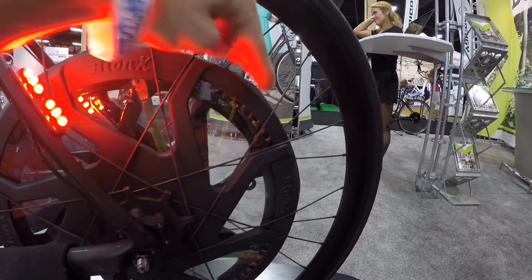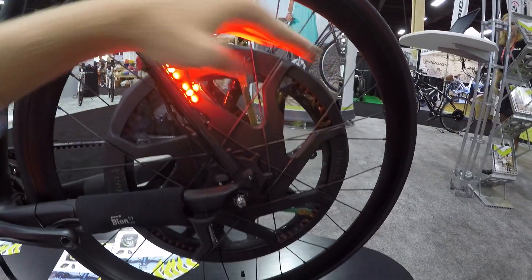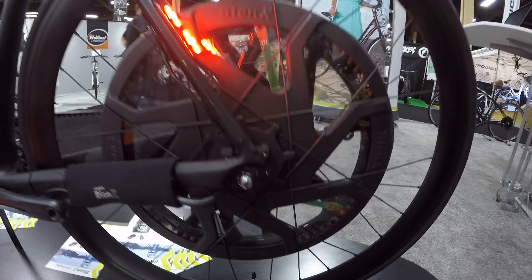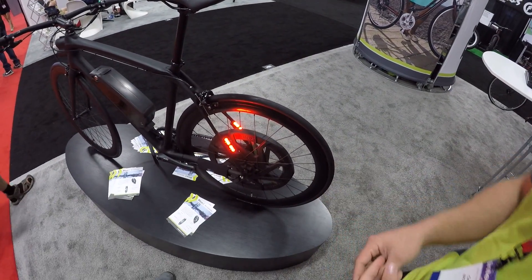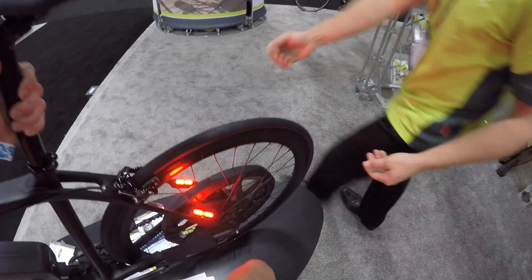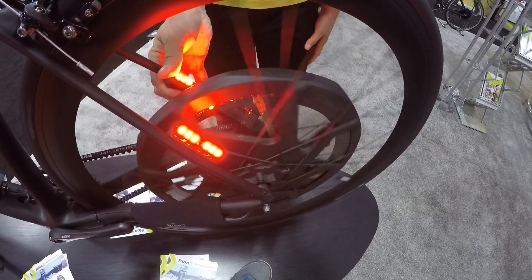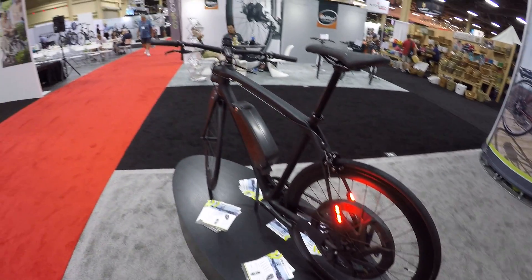These are the electromagnets, and then there are neodymium rare earth magnets around the perimeter. Instead of a few big heavy magnets, you have narrower but more numerous ones. That gives us reduced cogging torque, so there's less magnetic resistance — it makes for a really smooth motor for the rider. One of the great advantages is that it still feels like a normal bike. That's key, because cogging is one of the issues I'm always pointing out in reviews. Look at that wheel spin — that is definitely spinning freely. You don't see a lot of electric bikes that can do that many spins.